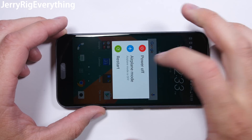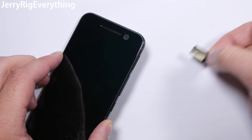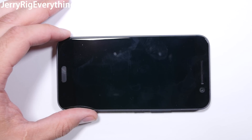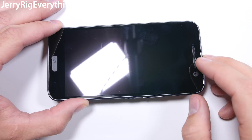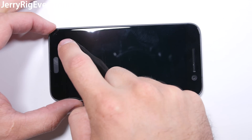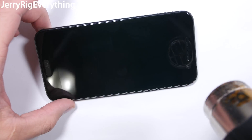Turn off the phone and remove both the SIM card tray and the SD card tray. I will link the tools and replacement parts down in the video description right below this video next to the subscribe button. A few things to watch out for: the playing cards or business cards you're going to use to remove the screen are going to slide over the earpiece. Watch out for the screen ribbons on the left side and the capacitive buttons on the bottom of the device. You'll understand what I'm talking about as you watch.